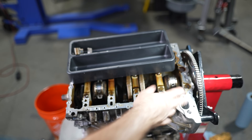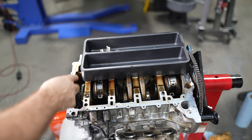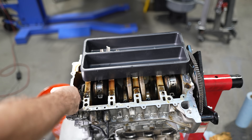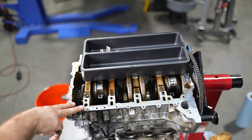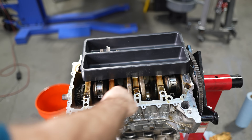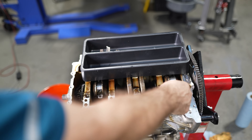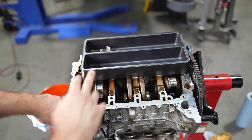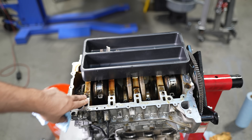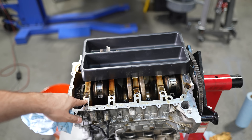This motor basically got starved of oil. The way oil would flow, this is probably the last one to get pressure. We need the updated timing equipment — the new updated parts like I did on the previous N20 — to update it so that the problem is no longer applicable to this engine. Then we're going to need rod bearings, crank main bearings, machine shop work on the crank or a polish — we'll see. One rod, and we're just going to put the same piston in with the same rings. And potentially a new oil pump because of the debris it went through.